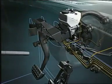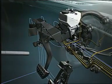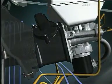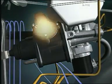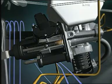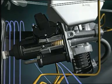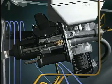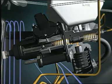The brake is activated by the pedal via the SBC actuating unit. This unit replaces the conventional brake unit. Sensors record the pedal travel. A hydraulic simulator provides the driver with the customary sensation of braking. The system also includes a tandem brake cylinder for the auxiliary brake.